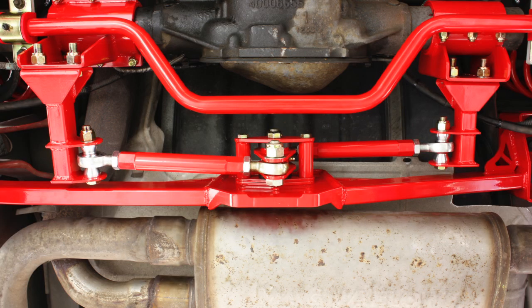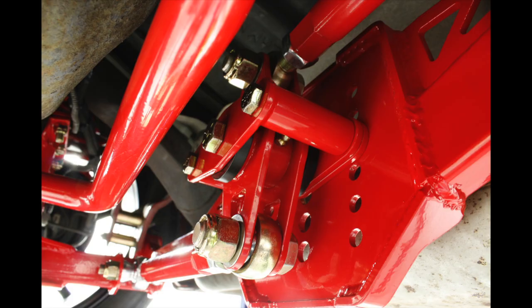The system can be configured in one of two ways: either the pivot is mounted to the rear end housing or to the chassis. If the pivot is mounted to the rear end housing, the links are mounted to the chassis. If the pivot is mounted to the chassis, the links are connected to the axle tubes. As the rear suspension travels, the pivot rotates keeping the rear end housing centered under the car.